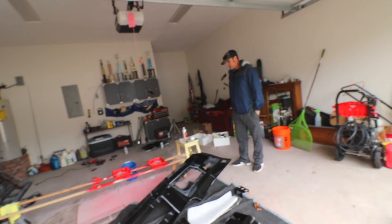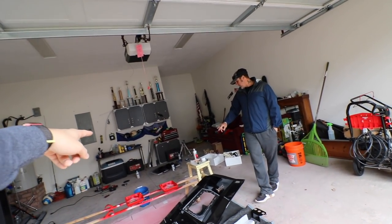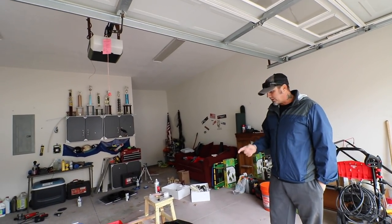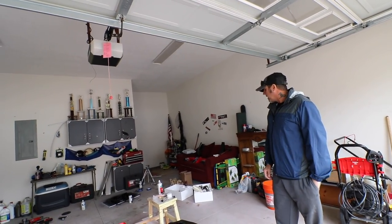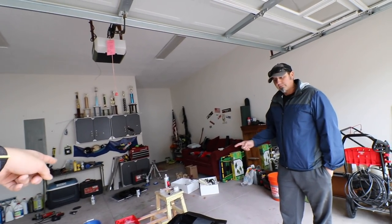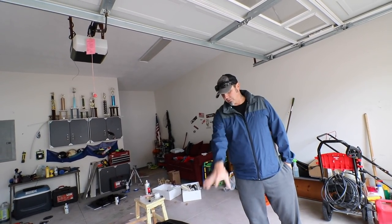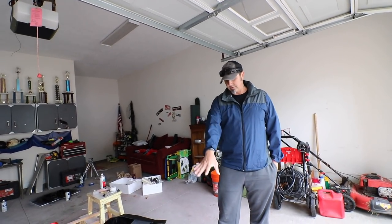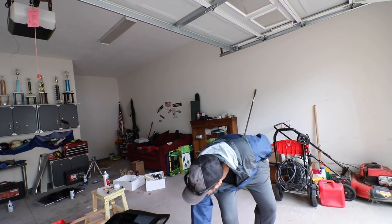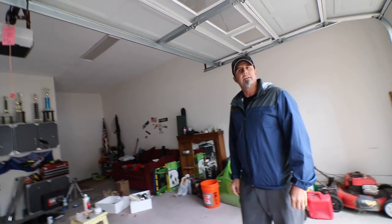Should we go ahead and put the fog light insert over there? We can do that last, right? Yes, you can do those last. Because you have the fog lights? Yeah, that's how I did mine. They'll fit right in. So we can just bolt on the bumper first and then work on that later. All this will go on last. The steps you and I went through were: get the bumper off, line the frame part up, put the bumper on, and we adjusted it. Then I put those in.